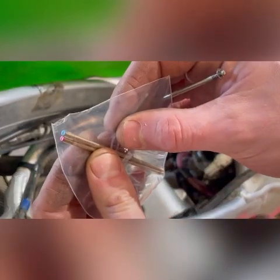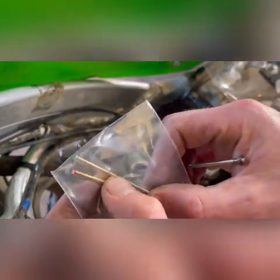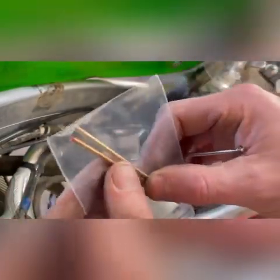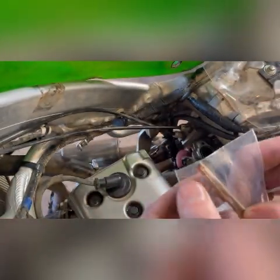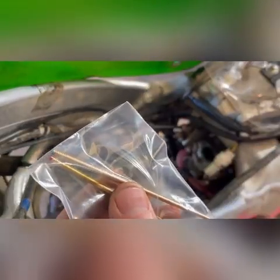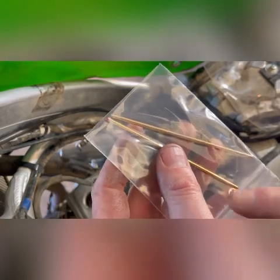See, they have a color scheme. Blue is for cold weather temperature, like North America. Red is for what they call normal temperature. In Australia, here at sea level, it gets cold, but it ain't that cold. So we're gonna go red, fourth clip down, just like it recommends. I'll set it up now and show you. The clip is down there.